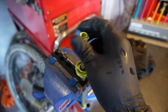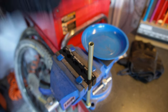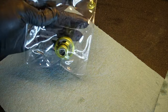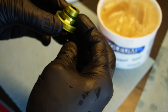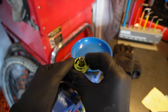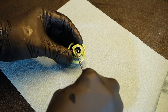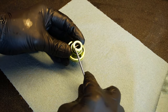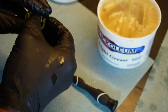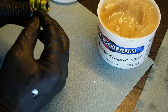Once the end plug is out, set it aside. Slide the stanchion plug off the rebound shaft. DVO recommends replacing it with a brand new unit — take it out of the package, apply a bit of grease to the O-ring and a little on the rebound shaft, then slide it into place. If you decide not to replace it, at minimum remove the inner O-ring, re-grease it, and reinstall it. It's a little finicky to get back into the inner groove — I used a golf tee to help seat it. Then apply grease to the outer O-ring as well and reinstall it on the shaft.